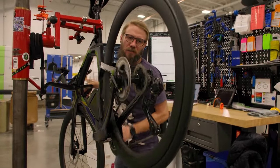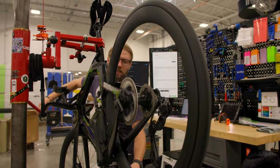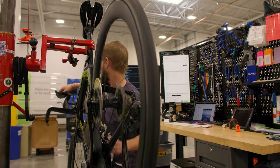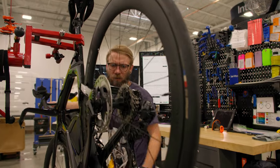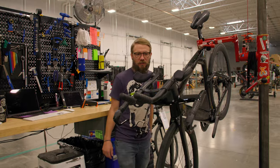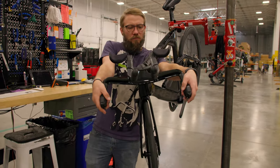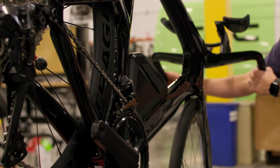Almost everything's internal. It does have the newer 12-speed Shimano Di2, which uses some cables. In this instance I believe TT bikes run fully internal. We're going to have to look into that a little bit more because there's no wear on this drivetrain, but it's not operating fully. Specifically regarding the shifting issues, these two lower brake-mounted shifters are operating the front derailleur, and that's operating.